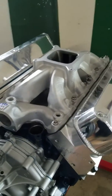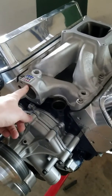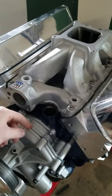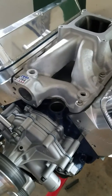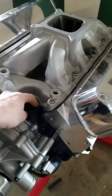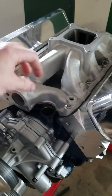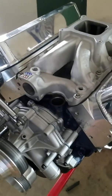I'm going to go ahead and torque all this down, put the water fill tube and thermostat housing on. I'm going to go ahead and throw in my distributor and make sure I've got a good gasket on that. Make sure that there's a little bit of lash in there to make sure that the distributor can move around freely. So I take the top off the distributor, and all of that will go in the next video.